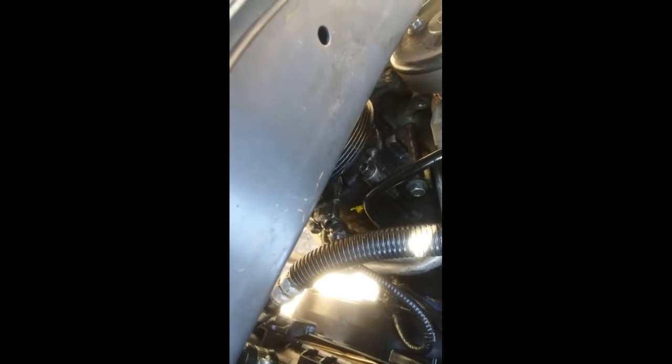From the top, you're going to want to remove the radiator hose. Move the headlight, move the radiator hose, and you've got a nice clear shot to get into your AC compressor. It's not as bad as I thought it was going to be. That one bolt at the bottom with the 10 millimeter on top was the most difficult one, but I used a ratchet with a 13 millimeter deep socket and was able to get it off. Putting it back together now, getting ready to hook the hoses back up and put the belt on.